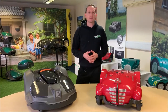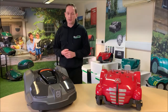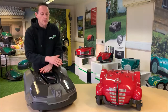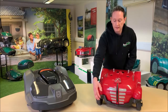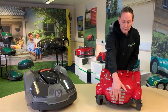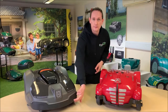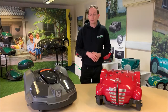Let's talk about some of the external features on these two robots, starting with the bumper collision sensor. Both robots use the same technology — a Hall effect sensor mounted underneath the top cover. The top cover is free to move in any direction in a fluid motion. So if the robot comes into contact with an obstacle from the right side it will detect that and turn left; if it strikes an object head-on it will reverse and change direction. This is far superior compared to older robots which have a very small bumper strip and aren't able to detect higher impacts on the robot shell.